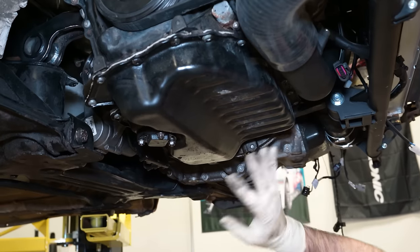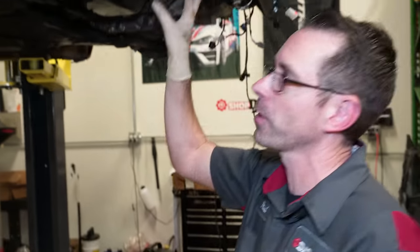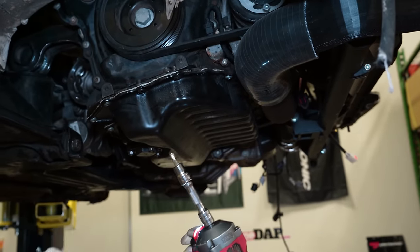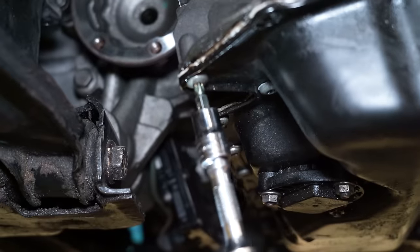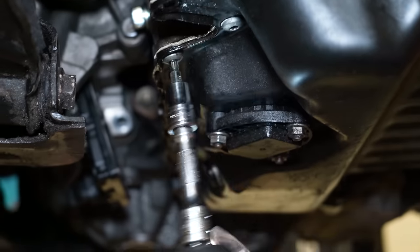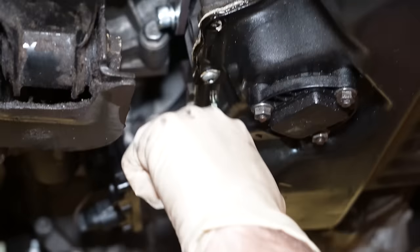In our earlier episodes, we showed this thing leaking oil everywhere. It's persistently leaked oil since then, which is why there's a small puddle even though I drained the oil. So I'm putting a new pan on this thing because I'm sick of this. The bolts were not very tight at all — someone went a little crazy with the RTV. You hear how it cracks loose? No wonder it's leaking everywhere — tighten the bolts!